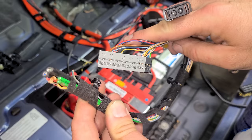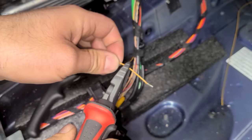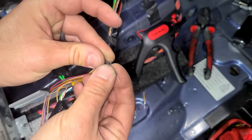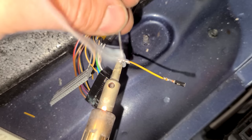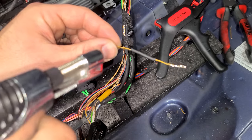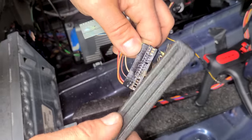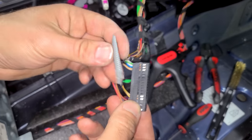Just a few bends away from snapping off - and there you have it, it just broke. No big deal because the used control unit came with a harness chopped right off from the junkyard. Cut the end of this wire, line it up with the new wire, give yourself a little extra length, strip both ends, don't forget your heat shrink, twist these together, and heat the wire up from the bottom - don't just go melting solder on the top. Slide the shrink tubing over, use a torch, and there you go - a proper wiring repair and pin replacement.